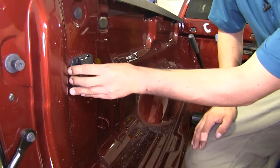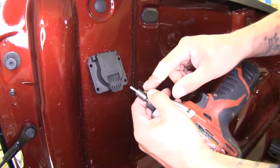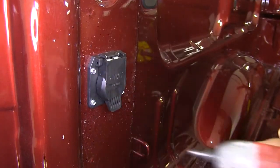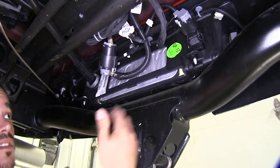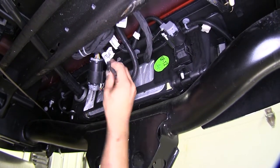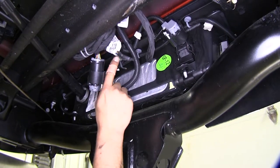Now I can feed this back in and get ready to mount it. Since I can't reach the back of my plug, I'm going to be using four self-tapping screws to put it in place. Coming to the back of our vehicle underneath, this is where our factory 7-way is in our bumper. Moving up just a little bit more, we can see our factory 7-way wires that are ready for the plug. We're going to cut these loose and get our wires ready to attach to our harness.